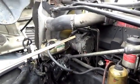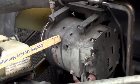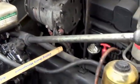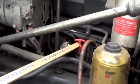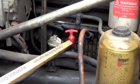The alternator — not cracked, not broken, and secure. The alternator bracket — no illegal welds. The alternator is belt driven. The cables — not cracked, not broken, and secure. Move over to your oil fill and oil dipstick — not cracked, not broken, and secure, no leaks. To check it: pull the dipstick out, wipe it off, insert it back in, pull it out, and it should read between the add and full mark.